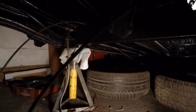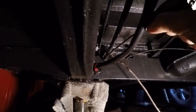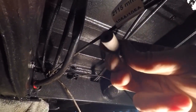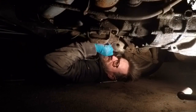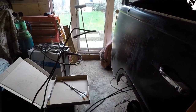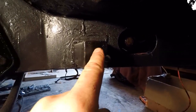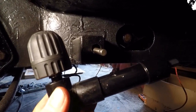It's so long I've pushed the new brake line in only so far, because what I'm going to do now is put these rubber sleeves around the middle section of it — they came off the original tubing — it just stops the pipe rattling inside the conduit. There we go, that's the entire length taken out from front to rear. I've got plans for that later on. Last time I came to a grinding halt because I couldn't fit my drill in this section to drill two holes for the bearing carrier on the throttle rod assembly. I've now got my angle drill so that'll get me out of that situation.